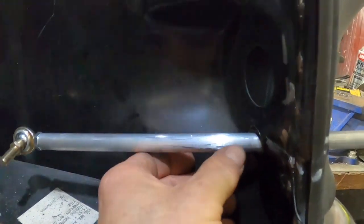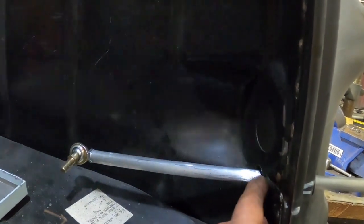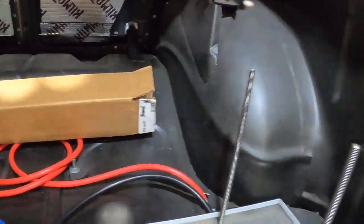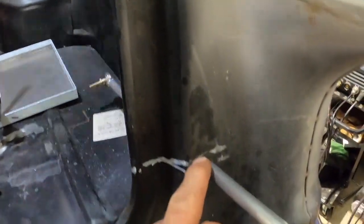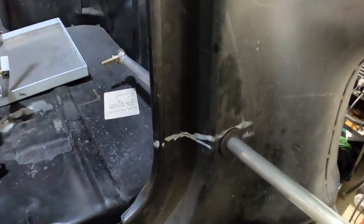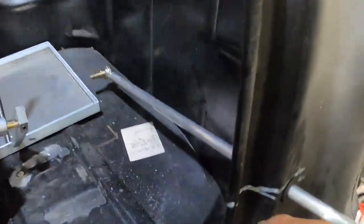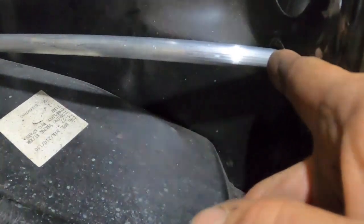I did the inside as well — that inside one's on an angle. So I'm going to use a one-size-over grommet for it. That Summit shutoff switch I showed you a few weeks back didn't come with any grommets, so I have my own. The outside one is kind of tight — I opened it up a little bit, but it works good. For the inside one being on that angle, I don't want it to bind anything, so instead of three-quarter I'll use the seven-eighths — it has just a slightly bigger hole.